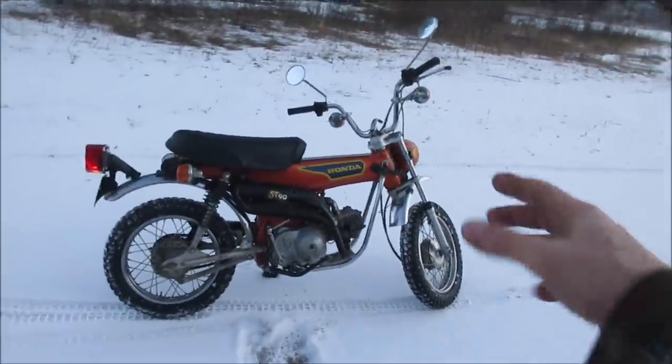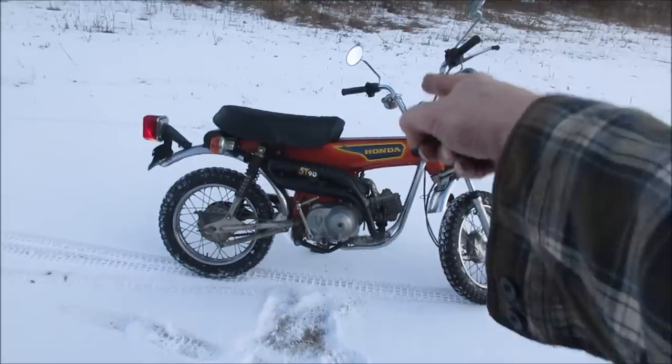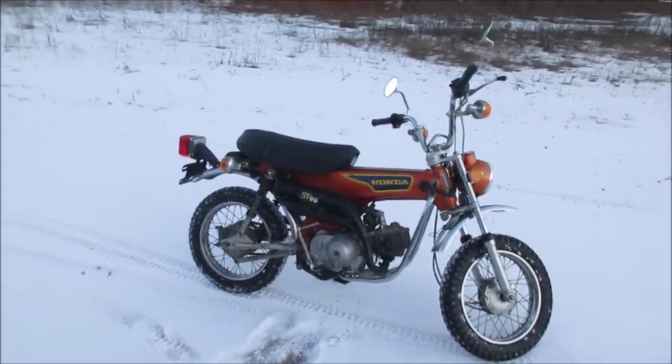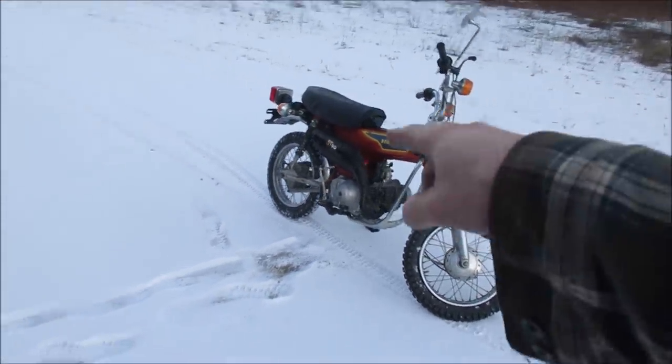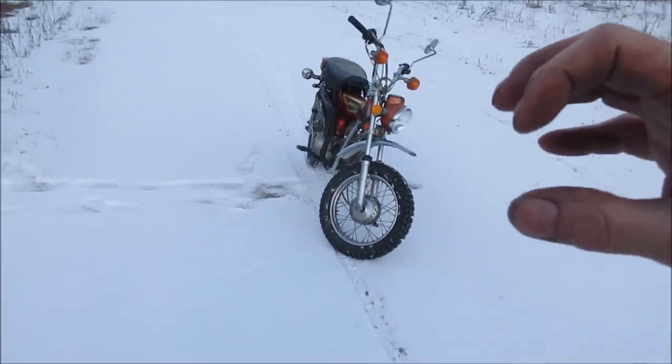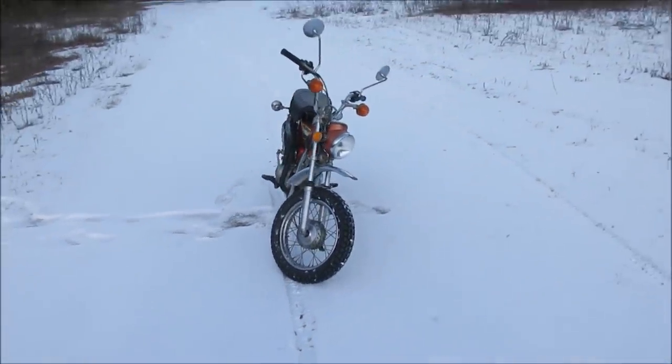Yeah, when I got it, the lever was turned. It was kind of twisted around on itself, and it had blown a fuse when I hooked the battery up. And then when I corrected that to the right spot, it turned around and didn't blow the fuse anymore.